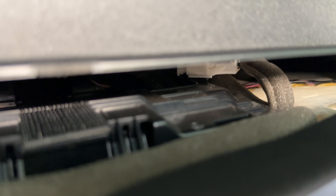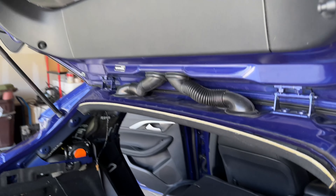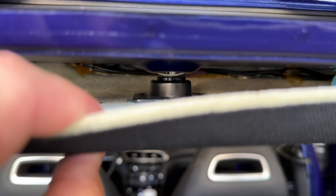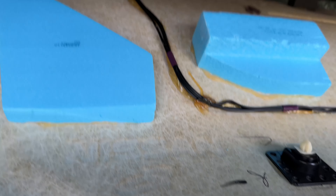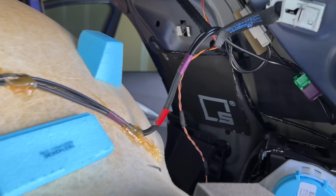I was able to pull it down and I can see this whole piece is not clipped into anything — that's good. Sure enough it's been velcro in the corners all the way to the back, and if I peek in there's one pop clip so I'm going to pop that. That was really the only pop clip. See all the little squares — all got velcro on them going around the whole way. Once you pull it down I just need to access the sunroof roll, which I'm going to unbolt. I'll undo this wire so I can drop it a little more.